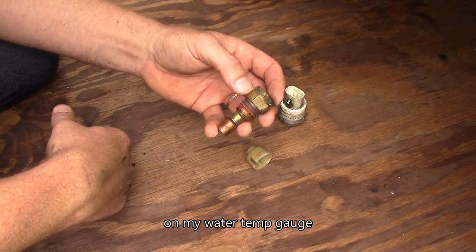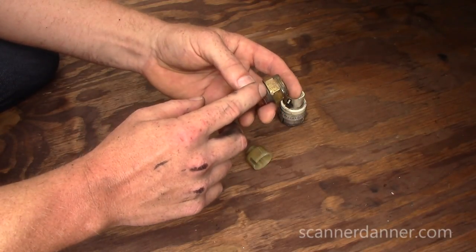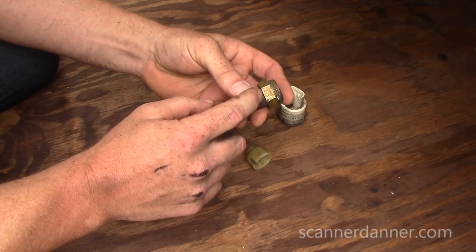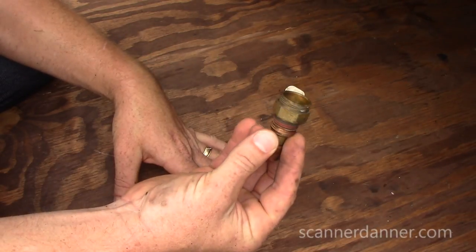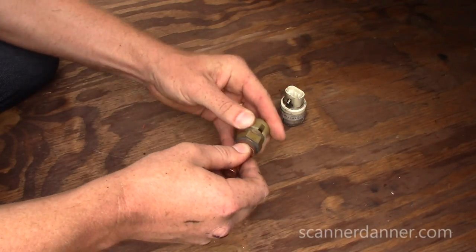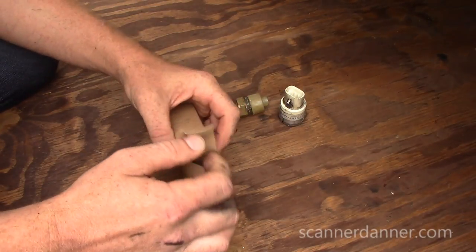I know when I was in Arizona last year in 110-degree temperatures, the most I saw on my rig was 200, so we're going to go with 215. I now know that if I see this overheat light go off, it's not smoking hot. I like knowing I have a lower number in there and we'll see how it goes. I believe this thing's been broken the whole time I've owned this rig.